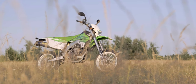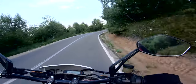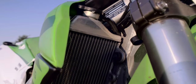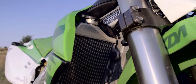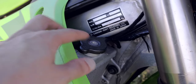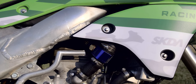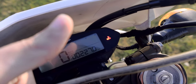Then we went into the first chapter: cooling. These bikes are known to run hot. And while in the case of women hot might be good, motorcycles are different. The KLX is known to run hot in general, and adding a stoplight to the equation, we needed proper cooling. The cheap hacky solution was changing the radiator cap to a high pressure one which doesn't allow water to boil out — it kinda works, but it's just a band-aid. The true solution was mounting a fan system to the radiator, coupled to a thermostat which turns the fans on automatically when the coolant reaches a certain temperature. The radiator doesn't have any factory way to mount a fan, so creativity had to be used.